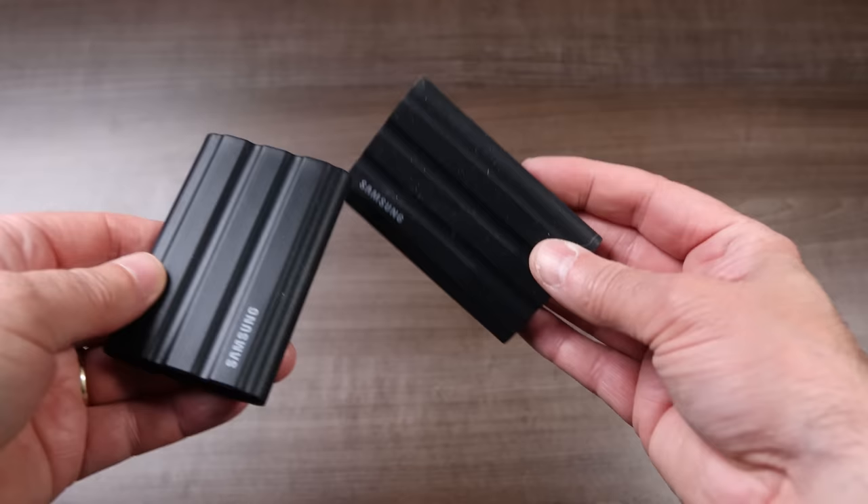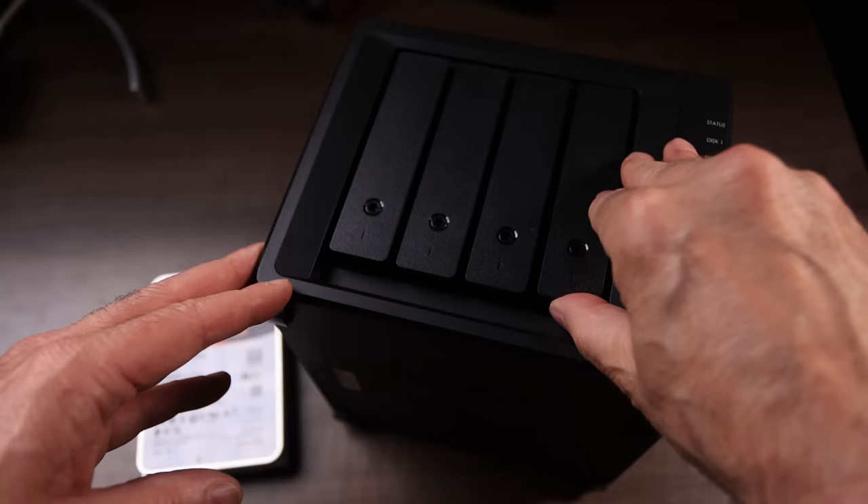At home I have what's called a NAS — a Network Attached Storage. I've been using Synology products for the last several years and they've been great. They haven't paid me for this video, but I'd be remiss if I didn't say thanks for sending me a new device as I beef up my storage before I go to Botswana, where I may come home with 5 or 10 terabytes of data even after daily culling. A NAS is a device that holds hard disk drives — usually more than one — connected to the internet and your computer. It stores and manages your data and can be set up to store duplicates for redundancy. With a two-bay NAS like the Synology DS220, one drive stores your data and the second is a copy. If one drive fails, the second is a carbon copy and you can replace the defective drive and reload the data.